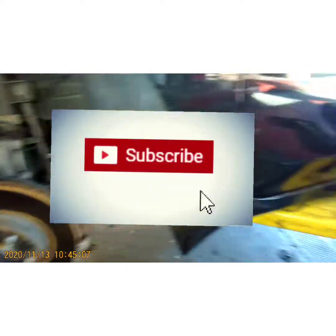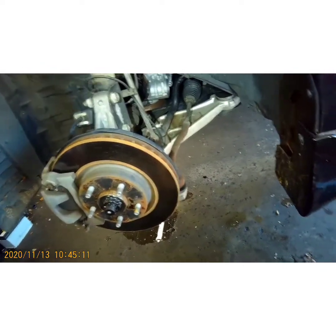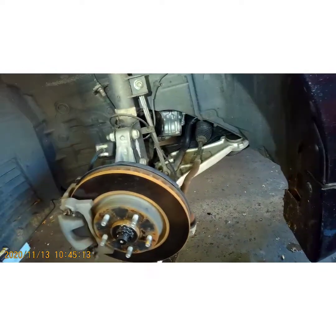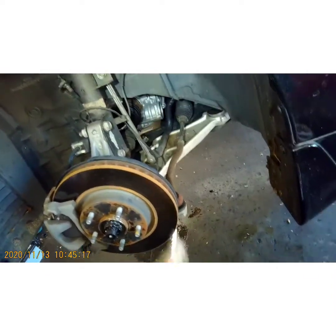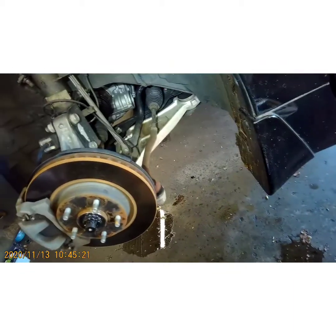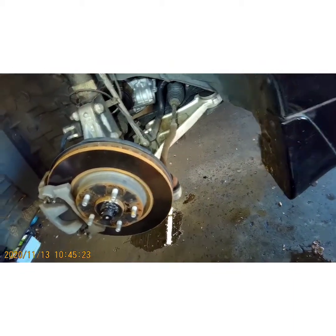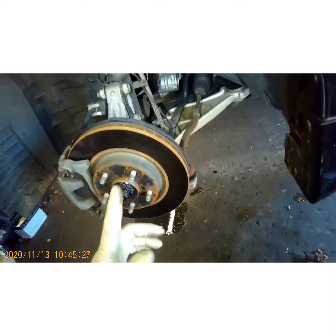What's going on YouTube — today I've got a 2013 Nissan Altima with the V6 3.5 liter. I'm going to be showing you how to replace the left front CV axle. The problem with the current one is it's leaking grease and vibrating on acceleration, so the customer decided to go ahead and do it — that's what I recommended.